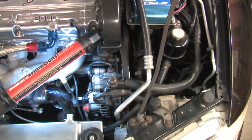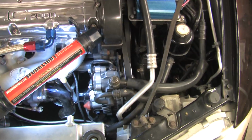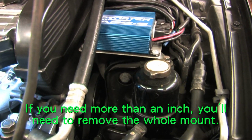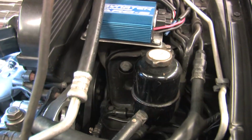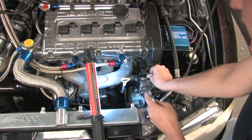So I'm going to take that thing off and take the lower pin of the alternator out. If I need to lower the engine, the bolt for that is right there. I can pull that thing out with a jack underneath the oil pan and lower the engine so I can get to the hole a little bit better. And enjoy.